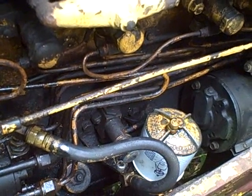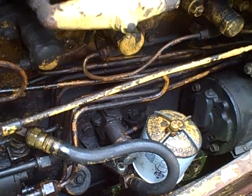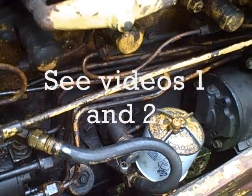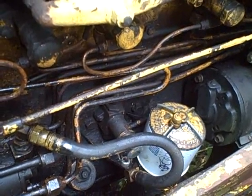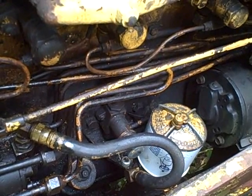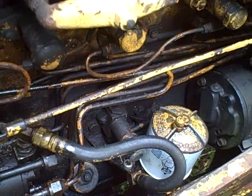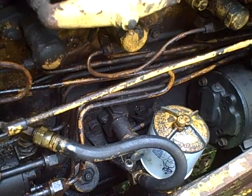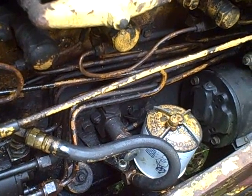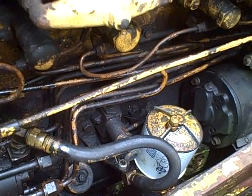The reason I don't think compression is what's stopping it from running right now is because I had this thing running, I shut it down, and then when I went to restart it, it didn't want to start. If I had been running it at full throttle and it suddenly just stopped, then I would suspect an internal mechanical failure — like a hole in a piston — that caused the problem.